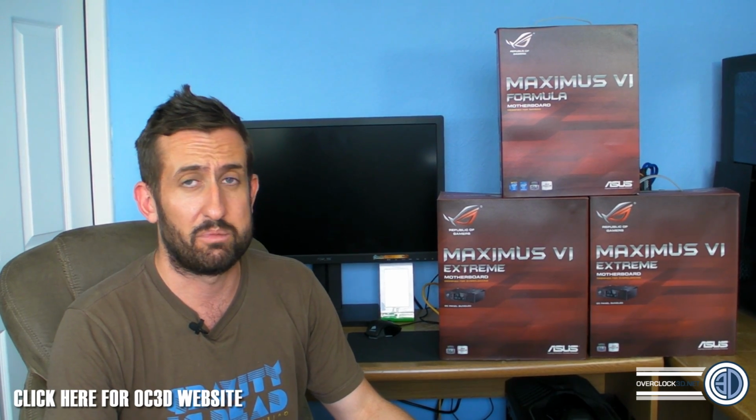I'm no world record overclocker, and there was a world record overclocker that had a little pop at me about the fact that I didn't do the uncore overclocking. And to be fair, I've done uncore overclocking now and redone all the benchmarks, and it's not made a blind bit of difference. We don't know why. We've tested 3 different boards now, and we've gone from about 3.9 gigahertz uncore up to 4.5, because our review CPU doesn't really like uncore that much, but with a 600 megahertz boost, we're not really seeing any differences at all. All the graphs are pretty much within handfuls of points between them.